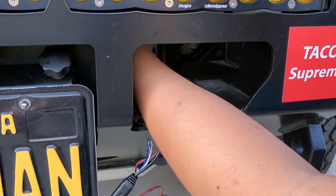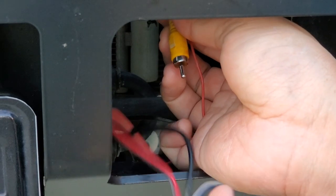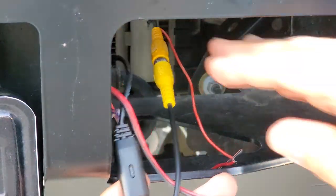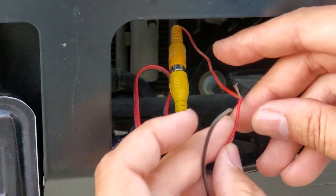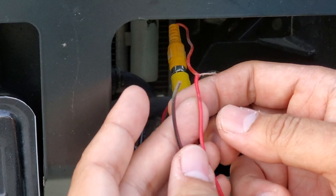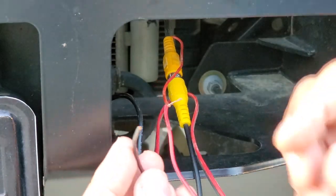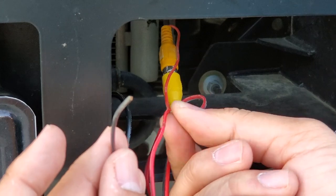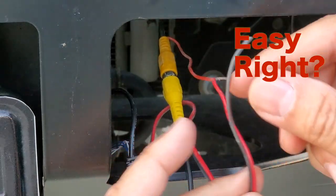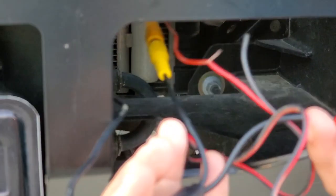Let me get down here — as you can see it's actually pretty short. This other part is the AV cable, it goes right there. I just twist-tightened this, but you generally want to crimp it or solder it — I only twist it because I tend to remove these things a lot and the winch is coming soon. Also, I noticed the ground wire isn't needed here because the RCA cable acts as its own ground. That's how simple it is to hook the camera up.